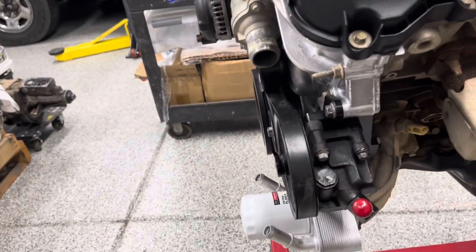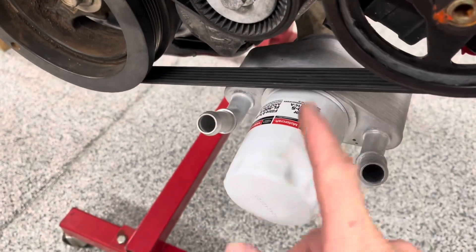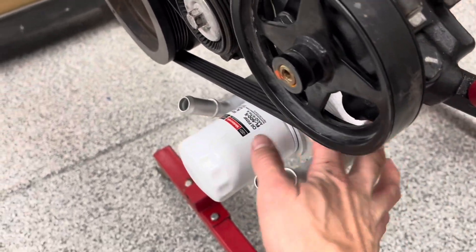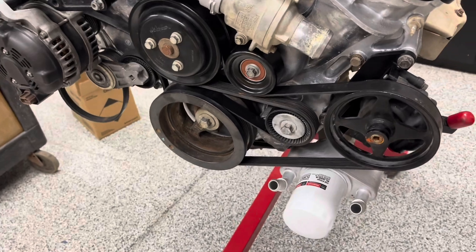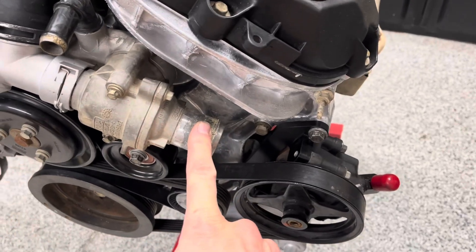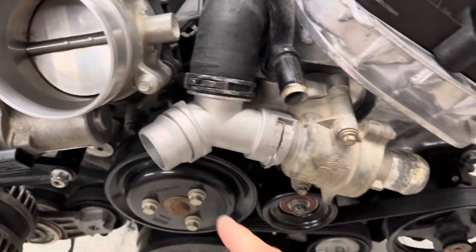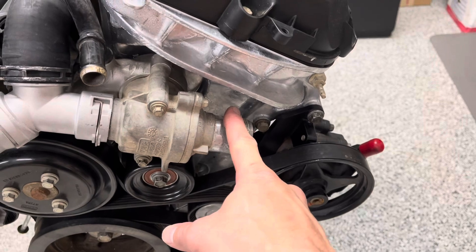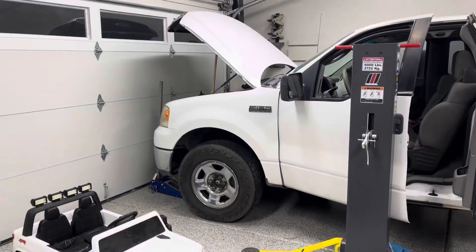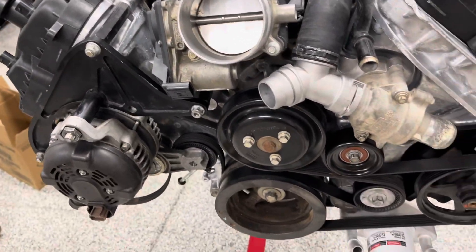Now I've got the truck here and I've been looking back and forth on things. This looks like it's probably going to hit the rack, so worst case I need to just get rid of the oil cooler and run a filter right on there. I think that'll be enough — I'll tuck the filter right underneath the belt. Looking at the radiator, the lower radiator hose for the Coyote that connects to the radiator is like a quarter inch diameter smaller than what's on the truck. So if I get rid of the oil cooler, I'll probably just use a standard GT without the oil cooler lower hose for the Mustang to fit that up. The upper hose on that truck is bigger, so I might have to persuade it onto that radiator.